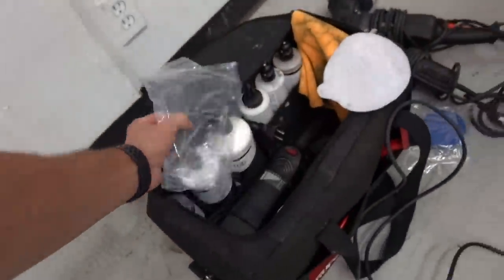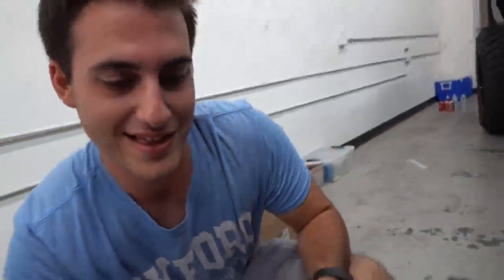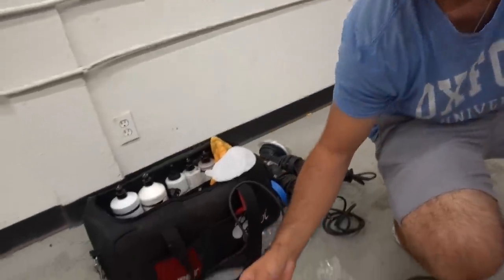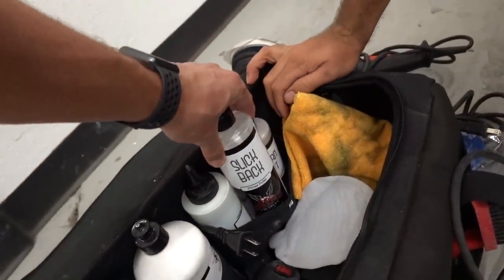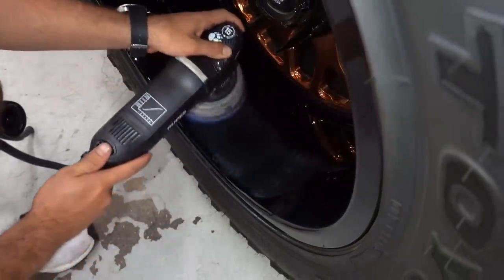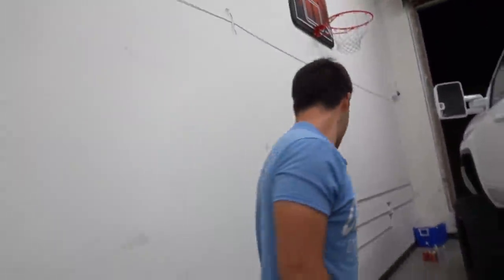That stuff smells rooty tootie, that stuff is amazing - huge fan, I got five gallons on the way. How's the trailer setup holding up? It's doing really good. Look at all those scratches. All right doc, what are we going to use? I like that you're pulling out a sterile pad out of the package - we don't want to infect my wheel with anything. This is a Lake Country HDO blue pad, it's a cutting polish pad so it won't cut too much but it'll polish out at the end. Second step is the orange one - softer, finishes out a lot nicer, no more haze. So we're doing like a two-stage? Yeah, just a little two-stage.